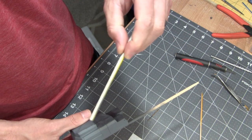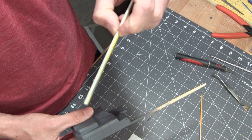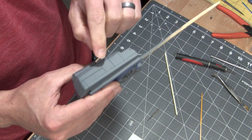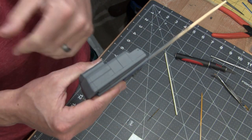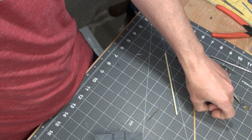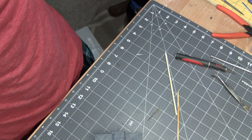And remember what I said, these guys aren't very good for that finished body work because they're squishy and they will start to go into wherever the weaker material is. So it will go into the voids where the sandpaper is, or it will go into the voids where the putty is.